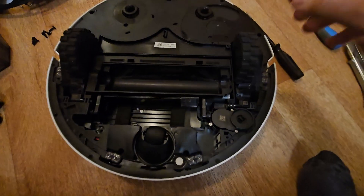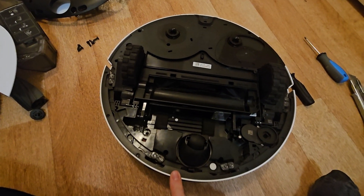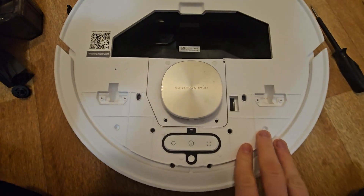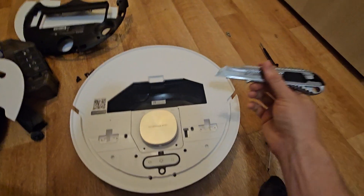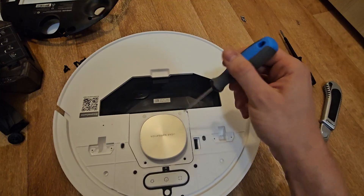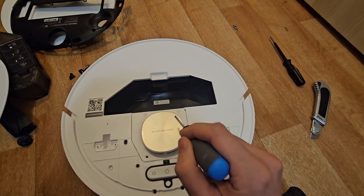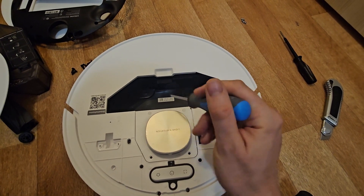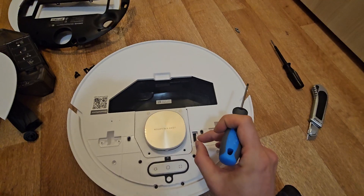The next step is removal of the front bumper, or optionally the lidar. Removal of the lidar is probably unnecessary, but if you ever need to do so, use the knife to get under the two colored screws, then a tiny Phillips screwdriver for the four screws and the cover comes off. The lidar device itself is held by three more Phillips screws. Undo those, then carefully lift the unit since it's still attached with a cable to the motherboard — squeeze the sides of the connector, gently pull it away, and you have the lidar.